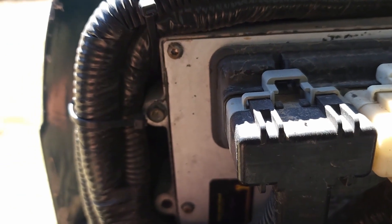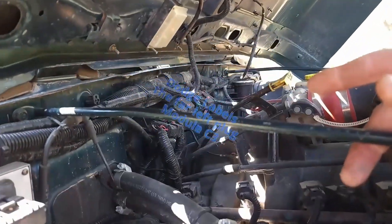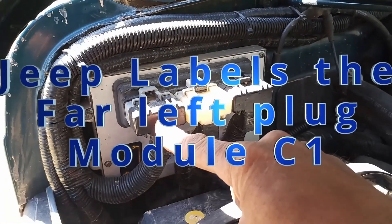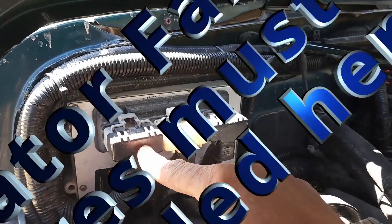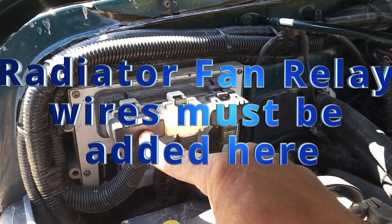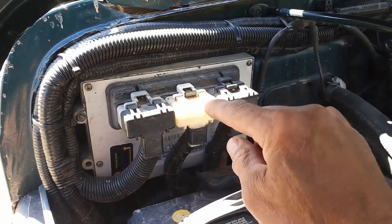Here's something that's really important when you start doing your build: between Jeep and Dodge there are discrepancies in the lettering of their plugs. This plug right here — the farthest one to the left on the PCM — is part of the Jeep, it is not part of the Dodge. In this particular plug there were two wires which had to be moved with a pin release tool to a different spot. Other than that, it's identical between the Jeep and the Dodge.